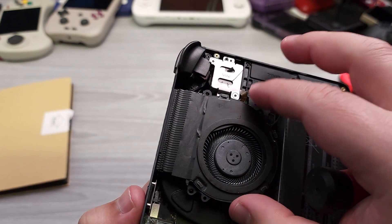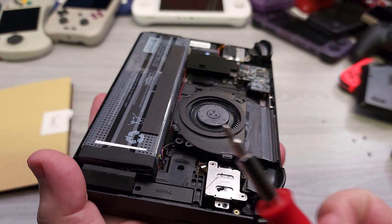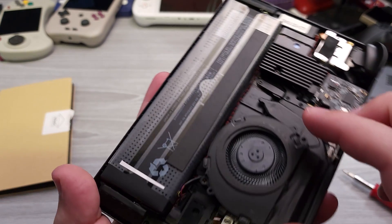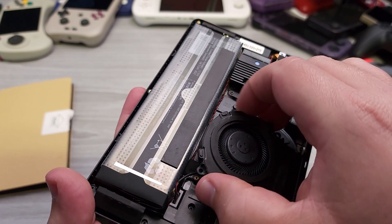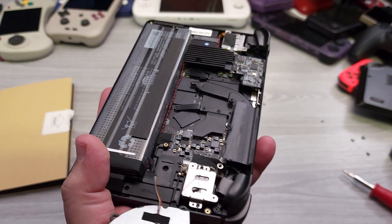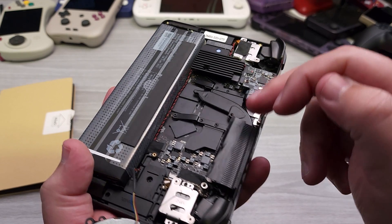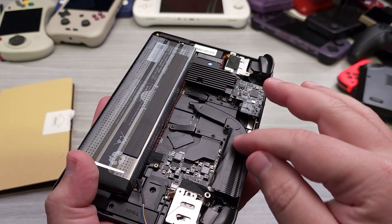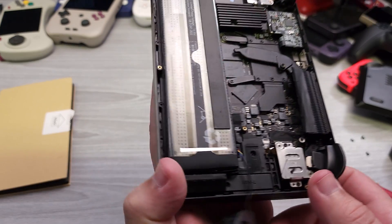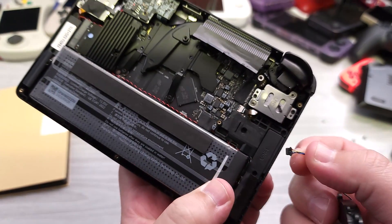Those three screws are removed, so now we can start removing the fan. We'll have to remove the power cable — don't use anything metal there because you might rip out the cable. There's also some tape holding down the fan which acts as a baffle to direct all the airflow over the copper fins where the heat pipe is. You can leave the fan connected on the side if you want — it's not that difficult to remove and replace.